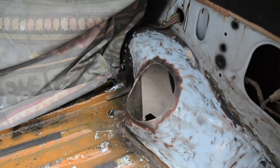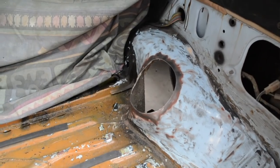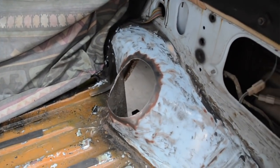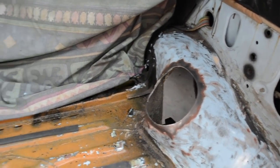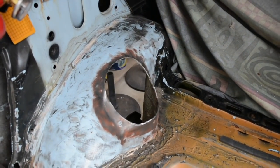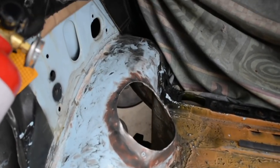The technique I used was, once I'd traced out where it wanted to be, I just cut it a bit smaller all around, and then as you saw, by trying to put the pipe in the hole, just ground it out till it was a good flush fit and sitting upright. There might still be a little bit of trimming to do once I get the coilover in place, but for now it's close enough and already all buffed up.